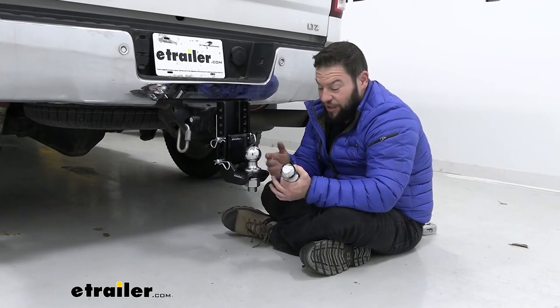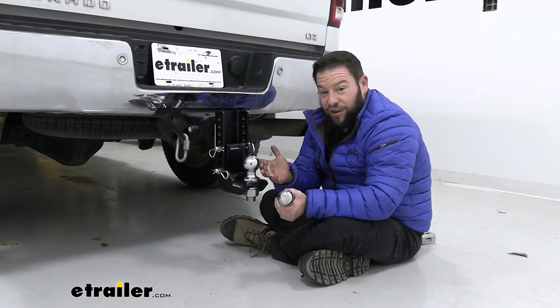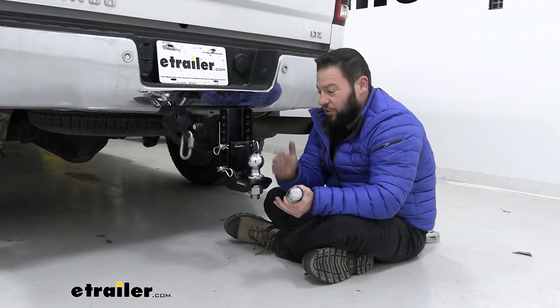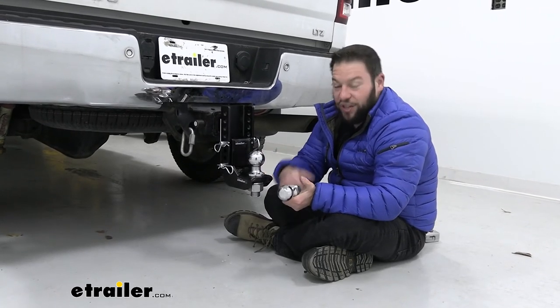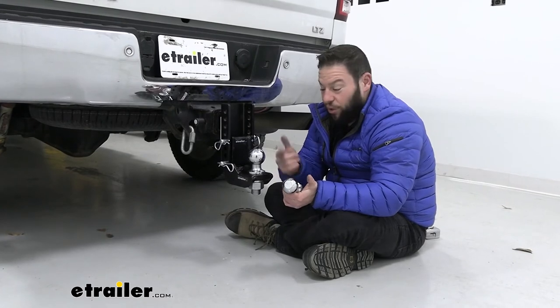This one you're going to have to remove and reinstall, then torque it down, which is very time-consuming and kind of defeats the purpose of getting the adjustable ball mount where you can flip accessories very quickly and easily. So I would suggest just getting another drop ball — get the two-inch one, have that on there, and just swap out the accessory when you need to. It's going to be far easier than loosening this and torquing the new one down.